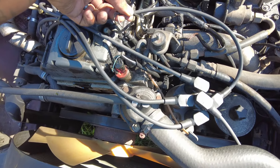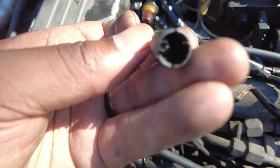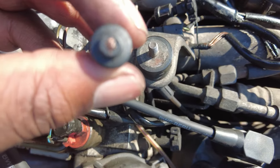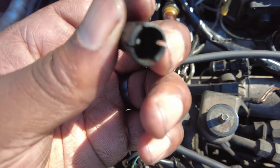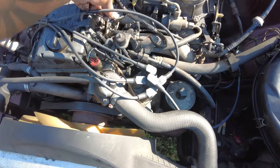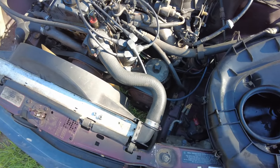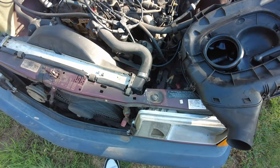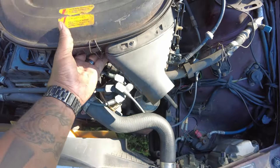As far as how we're going to fix the sensor, I don't know exactly — it needs to be depinned and re-soldered into this harness. I don't even know how you would pull this out. I'm probably going to take these two pieces home — there's not a lot of these cars hanging around. Maybe if I can find one in a junkyard, I would just take that harness with these two plugs, chop it off, and reattach them here. But I think I'm going to have to do this the hard way. So we fixed the problem and broke it. Sorry, Sam — your car is worse.